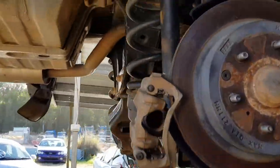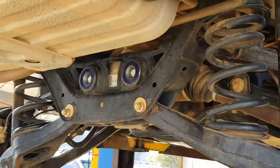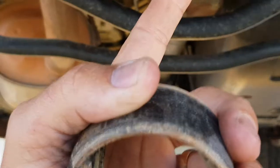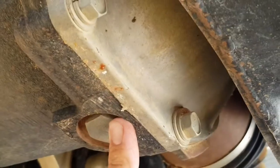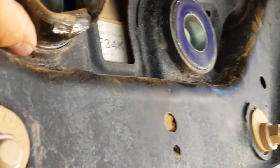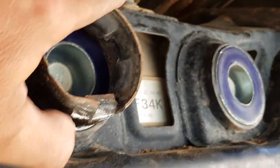You don't even really need the car up on the hoist to do it — you could almost do this in your backyard. So what we do is we get these ones. There's the bushes in there and they just flog out. You just knock those bolts out, put a jack under here to jack the diff housing up, and that was the part that was in there — we get stuck into it with the power hacksaw.